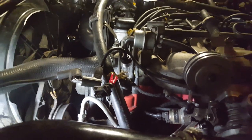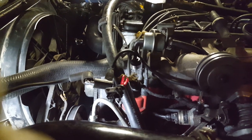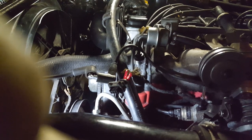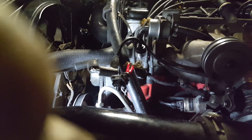Basically, these things require spark to activate the fuel pump. It'll start cranking and sparking, and then the computer recognizes it's got spark, so it kicks on the fuel pumps and fires up. That's why bypassing your fuel pump relay isn't always a good idea here because you could basically flood the engine — which I used to do a lot when I was doing my LH 2.4 swap from a KJet car.